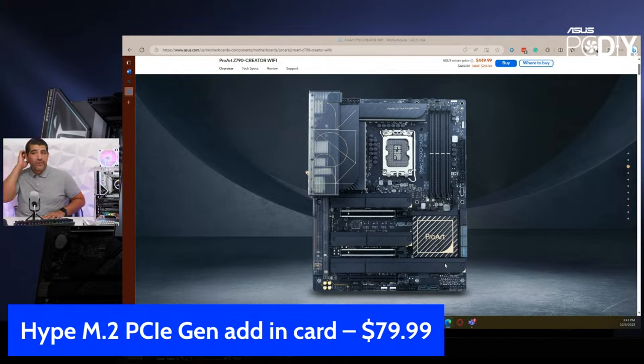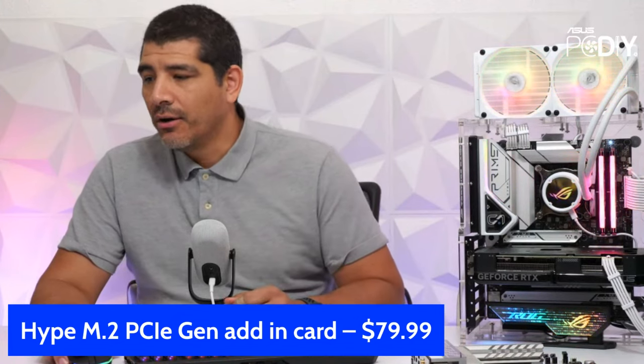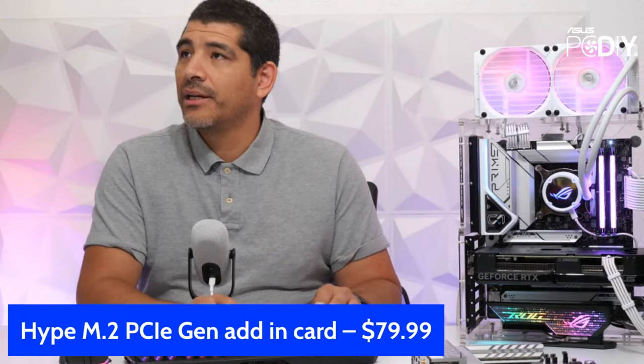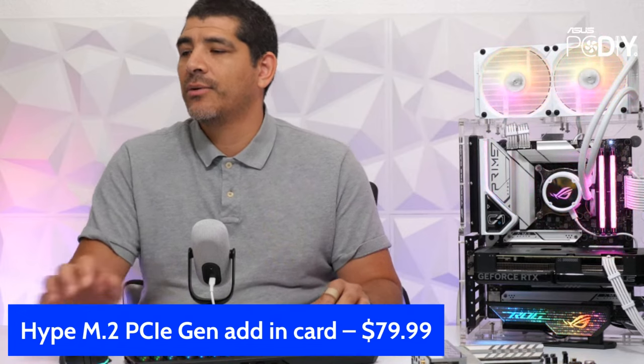Now, generally, if you move into what are called high-end enthusiast desktop motherboards, so things like TRX40, X299, and of course AMD, which has more PCI Express lanes for chipsets like the B650E or the X670E, you will have more liberal PCIe bandwidth to be able to support these types of devices. So hopefully that gives you some context in terms of items you want to keep in mind. I do believe there is an active link already up for this one, so let me go ahead and share that in there, and I'll quickly check to see if there are any quick questions on that.